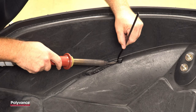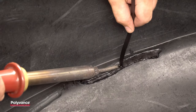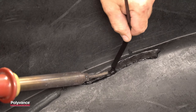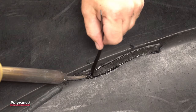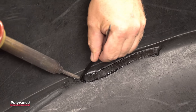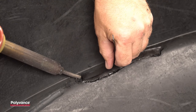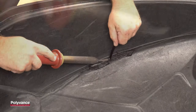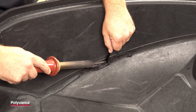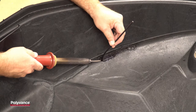Because the v-groove is so wide and deep, this repair will take several passes of welding rod to fill completely. Here we are welding with the O5 profile wide ribbon using the same basic process. Make sure the hot nitrogen gas is close in to the action, pre-melting both the hull and the welding rod, then fusing the two melted plastics together with a slight downward pressure on the welding rod. We'll make a second pass with the wide welding rod to completely fill the v-groove. If there are any voids or low areas, fill them in with the welding rod that fits the area best.